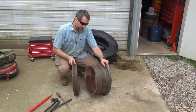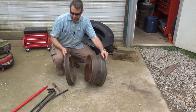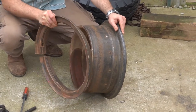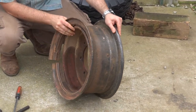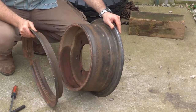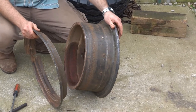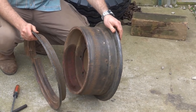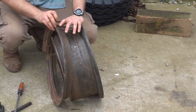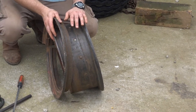Let's show you how it works. It has a little lip here in the main part of the rim, and then the ring snaps on — it's basically like a giant snap ring. It's why it's so dangerous: if you've ever used a little snap ring on a wheel bearing, axle, or U-joint, and that little thing slips when you're putting it on, it'll fly across the shop. Well, this thing can do the exact same thing, but it will kill you when it hits you.